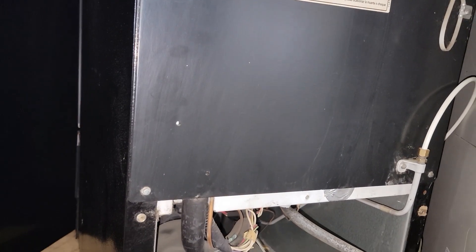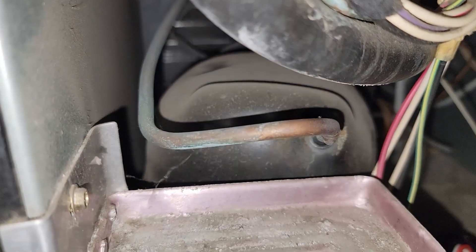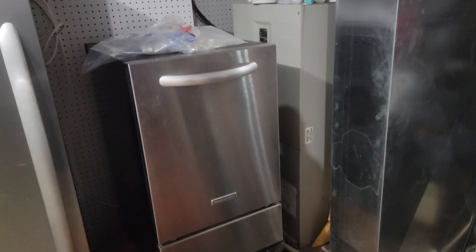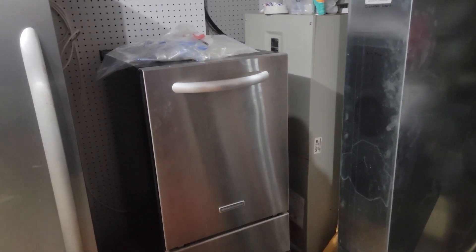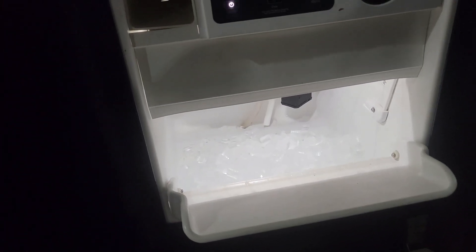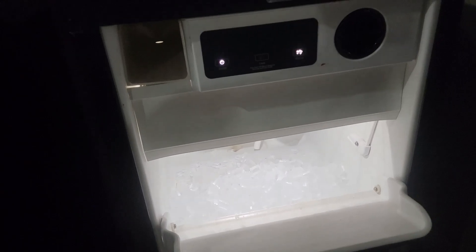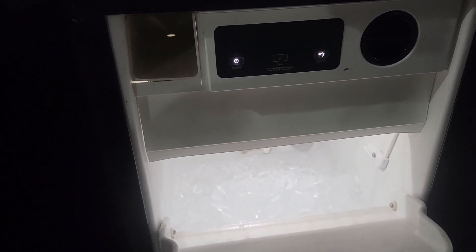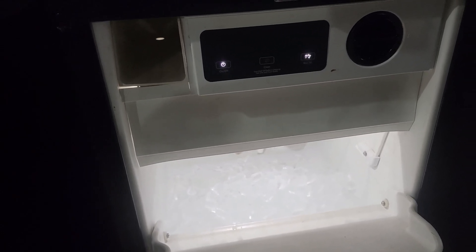I've let this sit for a couple minutes. It ran a couple of water cycles, and now the fan is on. It sounds like this is on, so we are going to see if it makes some ice. I put that start capacitor — or run capacitor, or whatever you want to call it, the three-in-one capacitor — in, and here we are five or six hours later and we are good to go. We are making ice, a considerable amount, and that was definitely the problem. Now I'm going to order the actual correct components to replace it with, but for $10 I figured out that this ice maker needed $50 worth of parts. Thanks for watching — I hope this video helps you. If it does, please subscribe to my channel, because that helps me and I appreciate it.